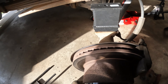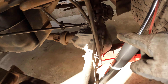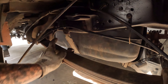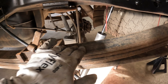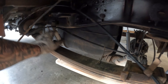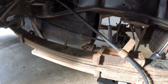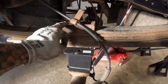We'll put the block on, but I still have to put the factory block in so I'll have to lower the axle more. Keep in mind your lines go tight. I might have to undo the line from the spacer bracket to give some slack. What I actually did is remove that bracket and another one to give lots of slack, and I'll put the stock bolts back in the stock holes for now. Now I can drop it more, put the factory block in there, and we'll see if the u-bolts are long enough.